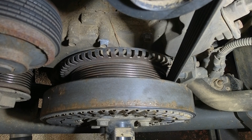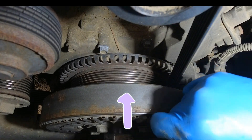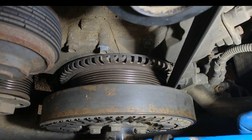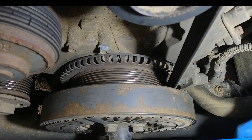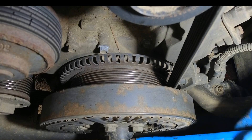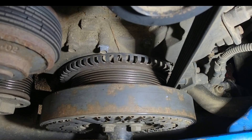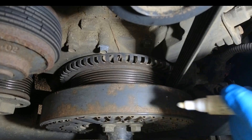No tools to put in the bell housing like on an MX engine — if only I could find the TDC mark, it's usually covered in 8 inches of paint. You can go round and round all day unless you know what to look for. I went past the mark so I took the engine back past it then brought it forward again to the correct place. Since rust has started to develop on the damper I've highlighted it in pen.